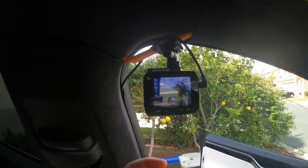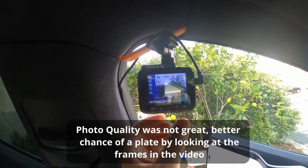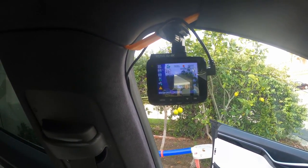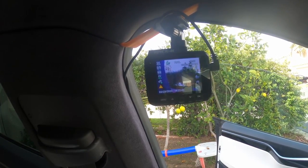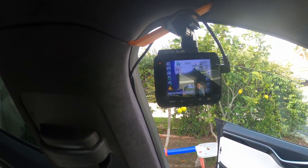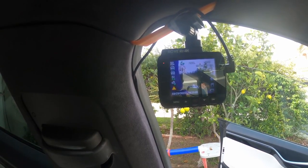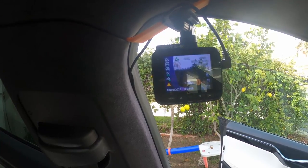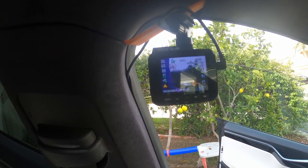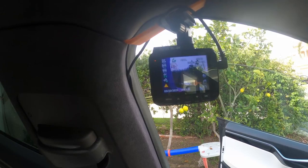Really learn your buttons. For me, the most important buttons on this Rovecam are this left button here — if I click it, it takes a photo. And if I'm driving and need to record the last three minutes of what happened, I just click that button and it's saved to a permanent folder that will not be overwritten. Learn those buttons so you can press them without looking. Try to make sure you've got an SD card of a really decent size, because as you accumulate video you don't want to run out of space. Even on loop recording, if you save a bunch of recordings you'll eventually fill up your card. Try to use high-end SD cards made for surveillance — they're designed to be written over again and again and won't burn out.